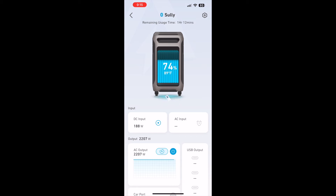On this next test, I have one AC on while making a cup of coffee with the Keurig. The AC output jumps from around 1,400 watts to 2,709 watts for that initial pull of power while it's pouring the cup. Then the AC output drops down to around 1,386 watts. As the coffee maker runs its heat cycle, it shoots back up to 2,685 watts, which really only lasts just under a minute.